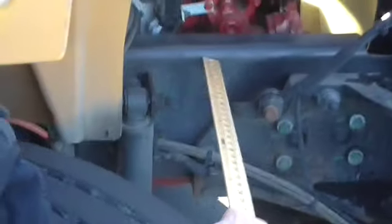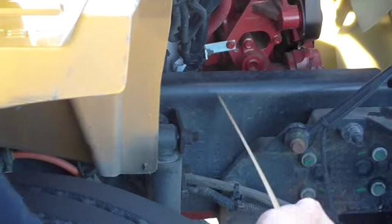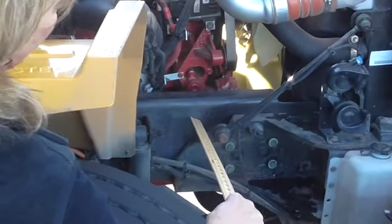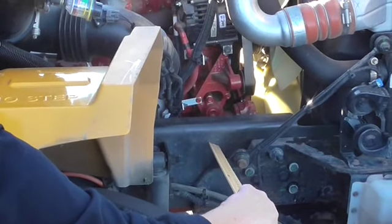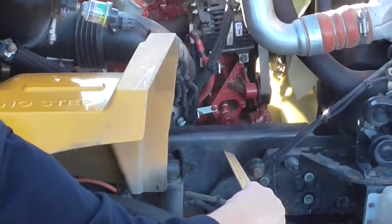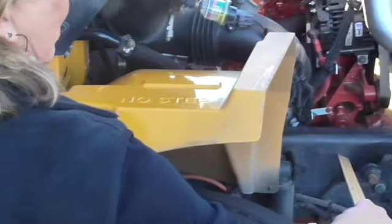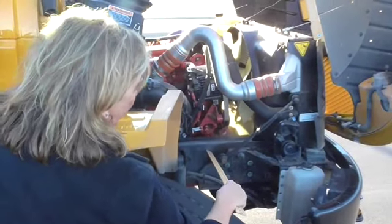This is my frame. My frame has two longitudinal members and cross members that run across those two longitudinal members. I'm looking at the frame making sure that it doesn't appear to have any stress cracks, any unnecessary holes, or any rust that could be causing a structural problem to my bus. We'll be checking the cross members as we go further through the bus.